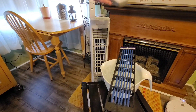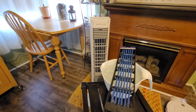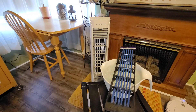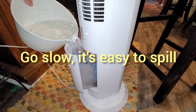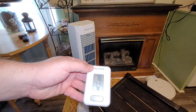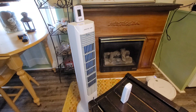It's now time for the moment of truth. The temperature in here is 78 degrees Fahrenheit, about 25 degrees Celsius. I'm going to stick this temperature fob down on the table so the wind is blowing at it to see if the temperature reduces. This filter has been in the freezer — it's reading about 39 degrees Fahrenheit, which is down to about 4 degrees Celsius. I'm going to put in the cold filter, add ice water to the basin in the back, and let it run. Let's check back in 30 minutes or so.